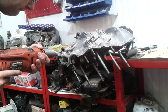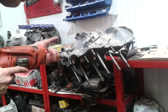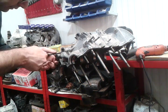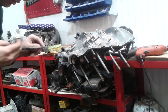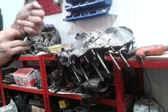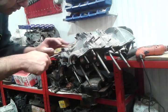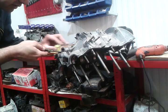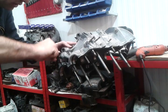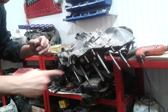The bottom one - here we go. Make sure you don't fit the tool in too much, just about five millimeters inside, just enough to hold into the aluminum. You don't want it to touch the magnesium at all. Just take your time and go slowly. There you go, loose. Just rounding it so it turns out easy. Sometimes there is some corrosion there as well so it has to clean its way out. Try not to pull from only one side - go up and down, left and right, and you're going to make a perfectly round hole.